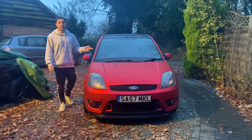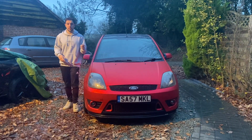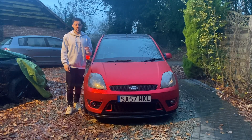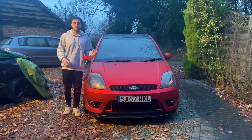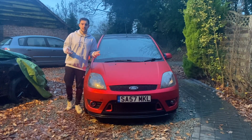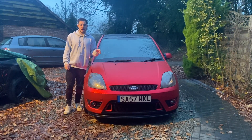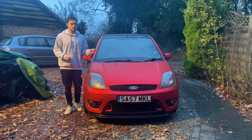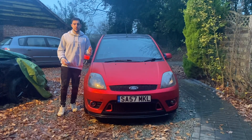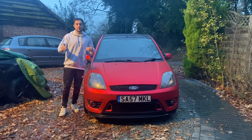Before we end the video, a couple of caveats about the testing. On the first run I just let the car warm up on the driveway then took it straight out, so it didn't really have much time to warm up properly on the road. On the second run with the cold air feed I had to drive for about 10 minutes before getting a decent stretch of road because I was stuck in traffic, which made the engine bay temperatures rise. I did notice it got down to something like 8 degrees intake temperature early on in the second run, but I couldn't replicate that later because the engine had properly warmed up. If I'd done the first run the same way, I think we would have seen a much higher baseline temperature, making the improvement even more significant.